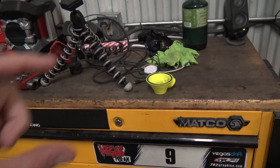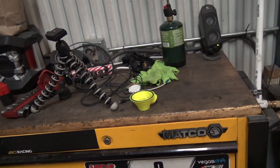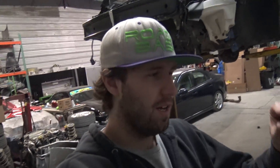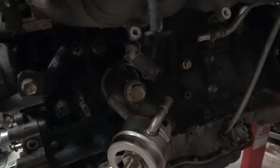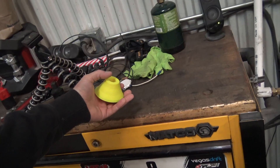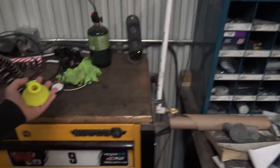It doesn't really need to be as tall as it is. I can make it a little bit more compact and a little bit better. I might not make this just a flat flange coming out — I might actually make it a little bit like a lip and then a loft. But I definitely need to figure out what thread pitch that bolt is right here holding the filter housing on, and figure out how far it extends into the block, because the bolt I want to make will be stainless but I want to make sure it's fully seated in the bore just like the factory one. All I have to do is measure the protrusion from the bottom of the filter housing. The bolt's going to be on here but it's going to have a dash-10 coming off of the bolt.